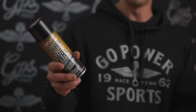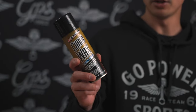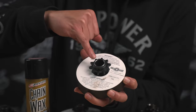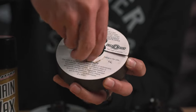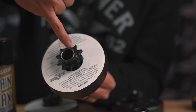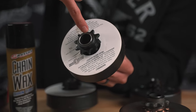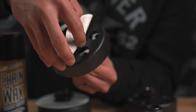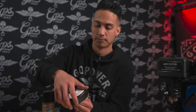With all of these clutches, it is best to keep them lubricated to prolong the clutch's life. We use Maxima chain wax here, typically once a week depending on how often you're running the clutch. It's best to spray your clutch behind the snap ring and onto the bushing that's going to be constantly turned — spray down in here behind your snap ring to lubricate it. Make sure not to get the springs with lubrication; keep those dry.